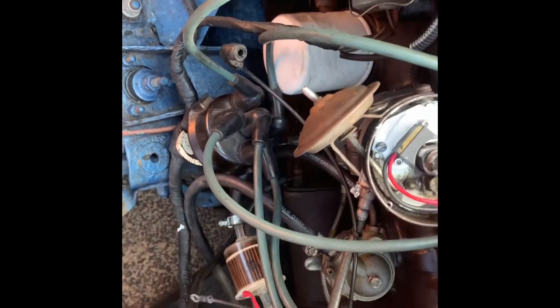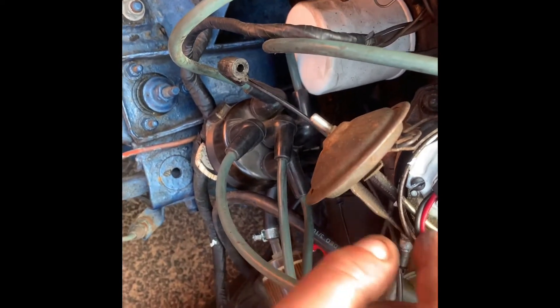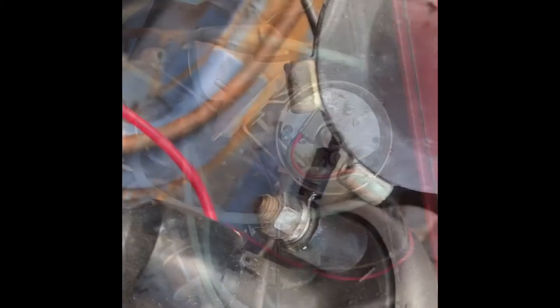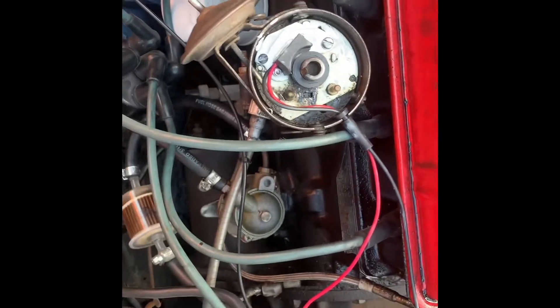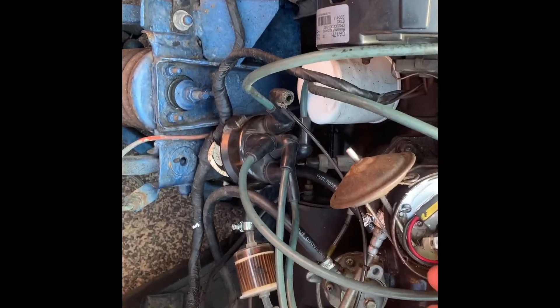What I'm going to do next is bring this round and put this over so it goes in like that. And now I'm just going to tighten up the cables, keep it nice and out of the way. So as you can see, negative's on and the positive's on — it's in place. Magnetic ring — I'm just going to place it on now. Sweet. Now what we're going to do is put the rotor arm on, obviously lining that up with this bit, like so.